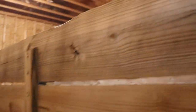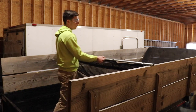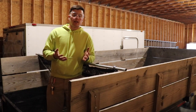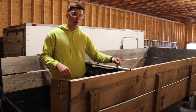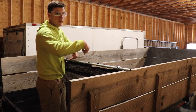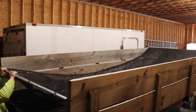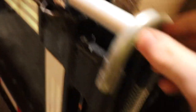You can let some pressure off and walk along the side just pulling the tarp with you. I'm doing it this way just to show you guys on camera more easily — normally you can pull it from one side or the other. The whole point of this was for me not to have to get in the dump bed, but I don't have an extra person for camera. So basically, the tarp goes over the top like this, slides right down, and then I go right over the top of that bar — boom, you're in. I'll push it all the way over so there's no way it can pop off, same on this side. The tarp's loose now, so I'll go to the front and tighten it up.